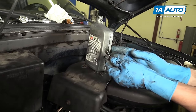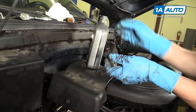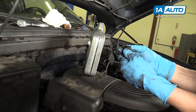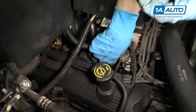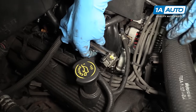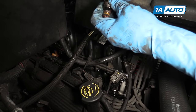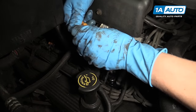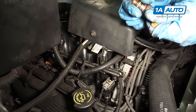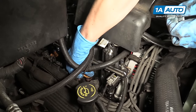Whenever I'm installing injectors, you don't want to put the seal together dry. You always want to take a little bit of motor oil and just wipe the top of the seal with it. That way it'll slide into the intake manifold and it'll slide into the fuel rail really easily. Here's the first one — we're going to put it right down into the intake manifold. With the oil on it, it just slides right into place. We'll go to the next one, wipe that with a little bit of oil on the top and bottom, and slide that one in. And here's the last one — again, wiping it with oil and then pushing it right down into the hole.